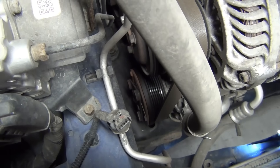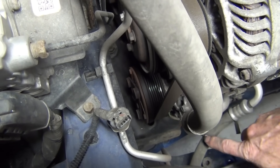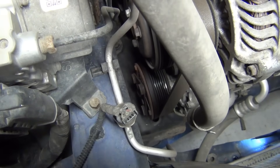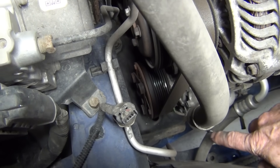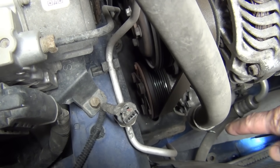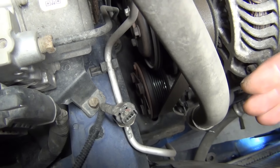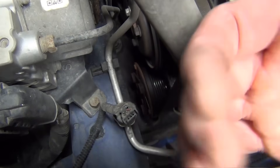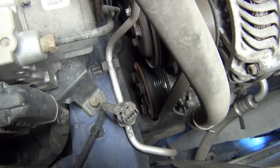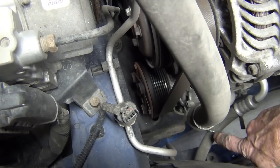Next up I'm going to start the car. I'm going to run power to this little wire right here and the center part should engage and rotate together. Why am I running power to the center wire? This wire gets power when a certain number of conditions are met — if your AC relay is working, if your high side and low side pressure ports are working, if you're at the right level of charge. All those things have to happen to send power to this.